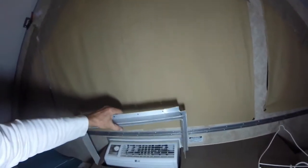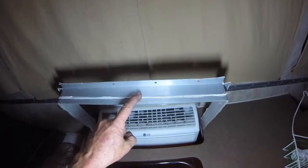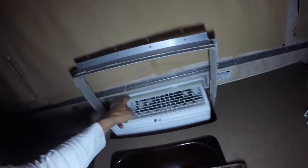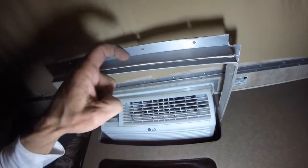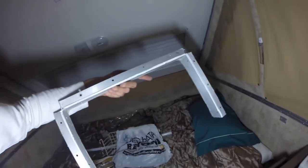At the A-liner now — this bracket is from my first one, and I'll show you what you see sticking through. Take your razor blade and cut this — you can see it corresponds to that right there. That's the strip of white latex you put in, and then this is the clear. Cut this one and cut this one. This piece of aluminum stays with the A-liner. This little half-inch piece right here is riveted onto the air conditioner, comes back in and helps secure it. Those are all the rivets that we drilled out.